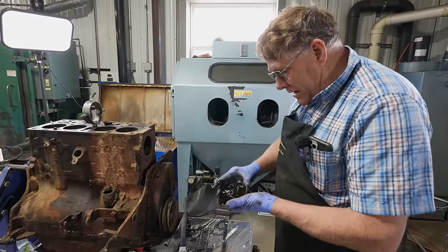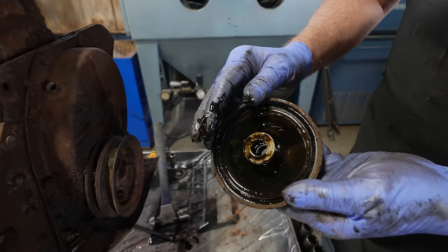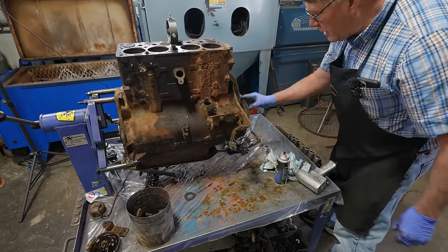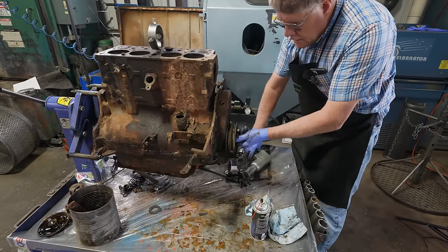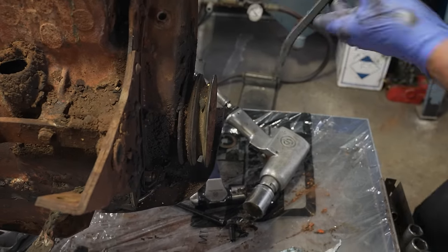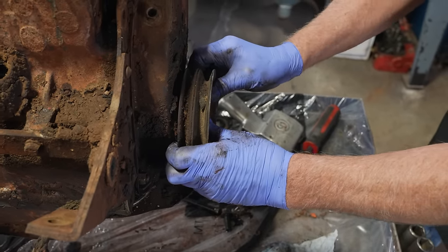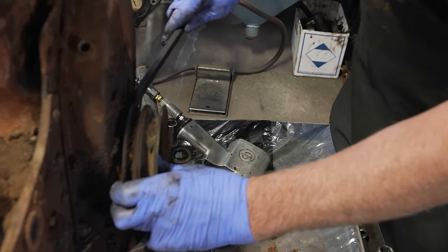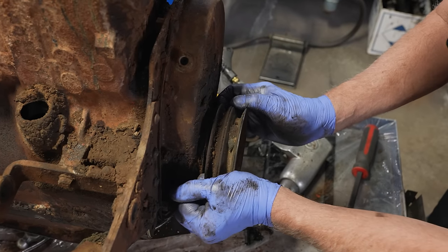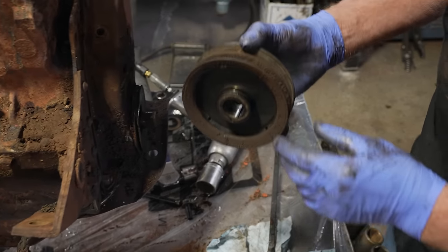This cap I would normally bake to clean it, but it has a spring attached to it there — I think we better just wash that first instead of destroying that spring in the oven. So we've got to figure out how to get this bottom pulley off. That nut came off easy enough. I don't want to do any damage to any of it. There we go, it's coming off. A lot of this stuff you just have to be kind of gentle and patient with it — grease and dirt, that's what makes it rough. You can't always see what you'd like to because it's so covered. And I think that's a piece we can bake and blast.